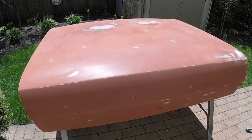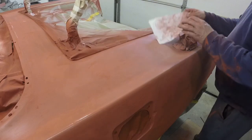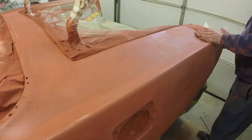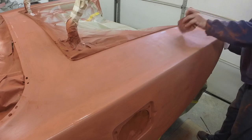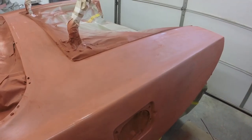I just spent about maybe two hours blocking that out and retouching, and I had lunch while the primer dried. I didn't count the dry time in my project here, so maybe another hour and a half for that dry time. The rear quarter panels are all blocked out, and I want to try and keep the dust down. So as I've been sanding, I've been just working the sanding dust down to the end here and wiping it off. The sides I've been wiping off too as I go.